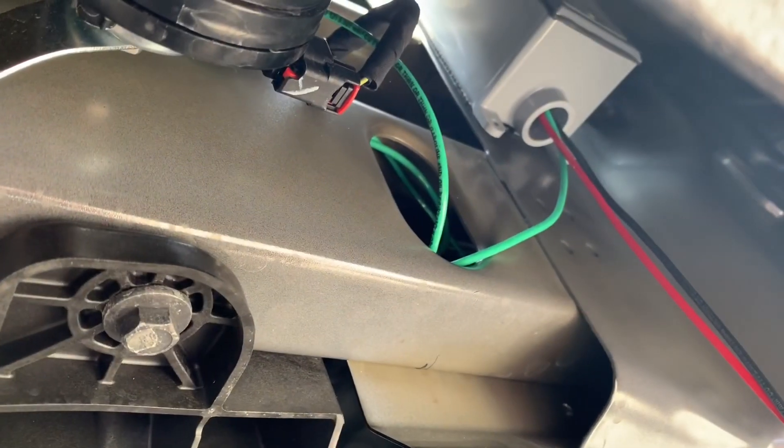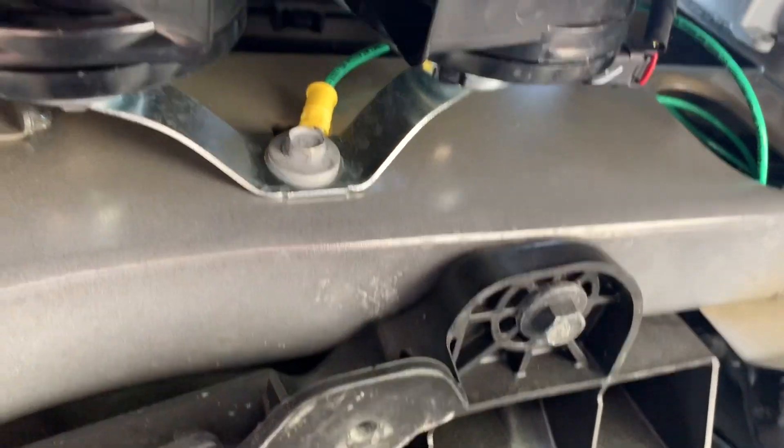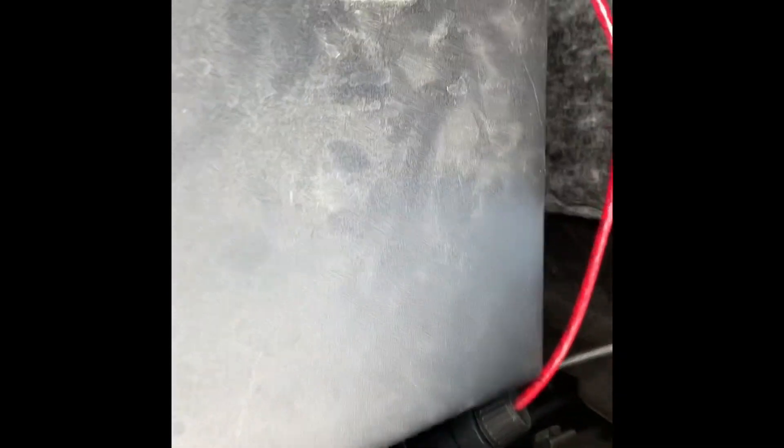I wound up getting the grounding cable, fishing the slack into the frame, and mounting the grounding cable to the horn mount on the actual frame. I'm going to fish the wire from there to the front access panel, because back here is where the hinge is at — if I were to fish it through there, I'd have to overlap this area and I didn't want it to get pinched. So I went with the shroud and fished it through there.